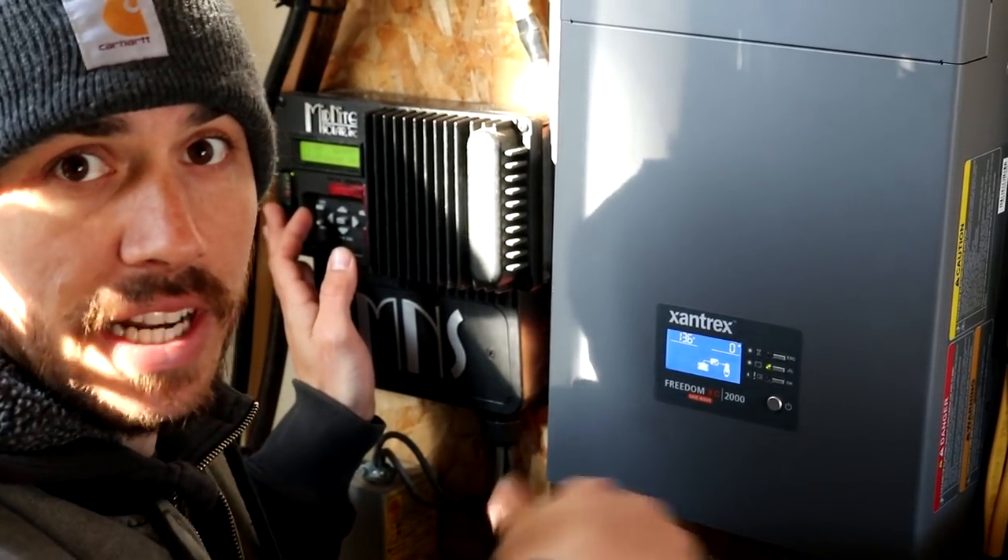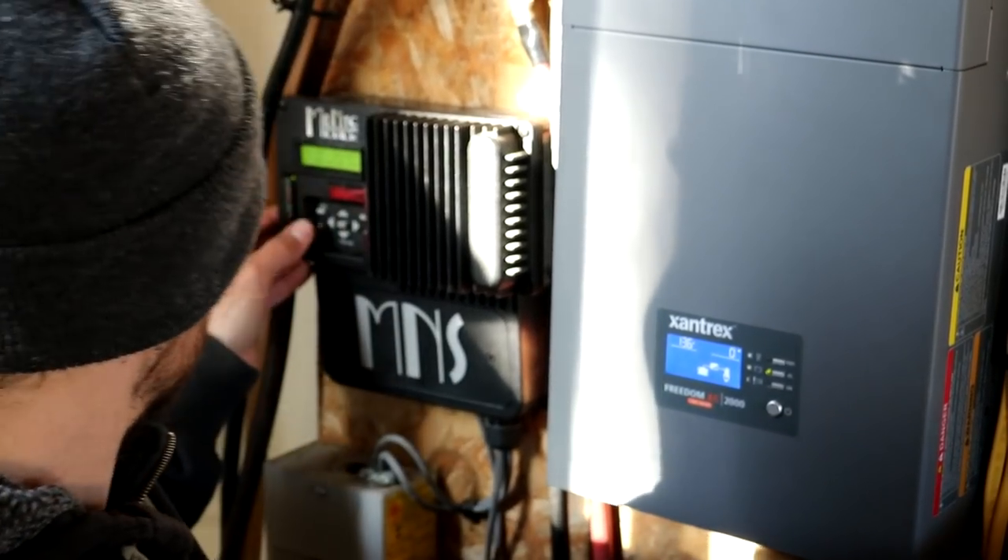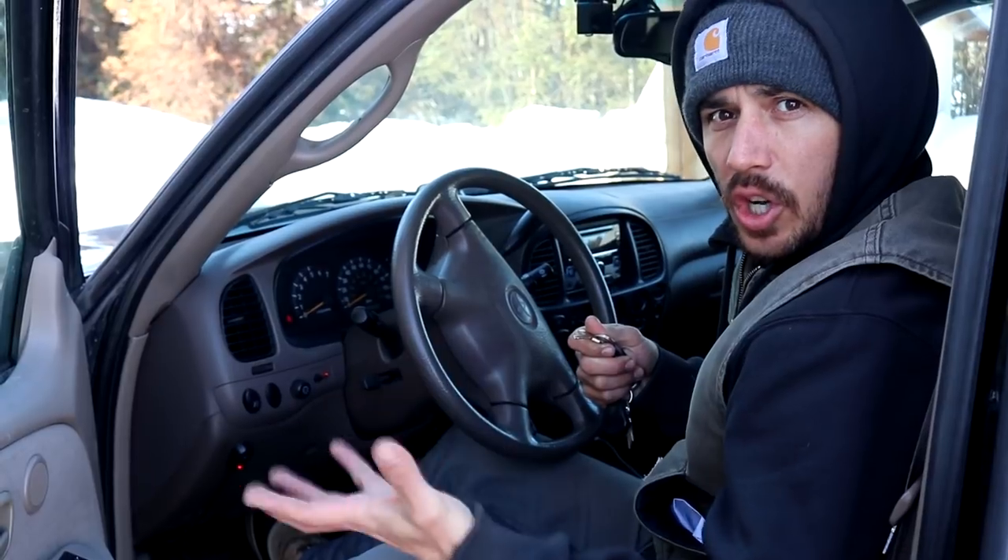So that leaves us enough time to get outside and start working on some other projects. First thing we're working on outside is we're going to be changing the oil in our Tundra. I'm going to get it fired up and warmed up and move to where we're going to be changing the oil, which is going to be in the middle of the yard. One of the reasons you want to warm up your truck before you do this — not just because it's really cold out, but even if it's warmer outside — you want to thin the oil so it all drains out completely.